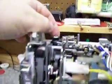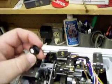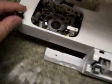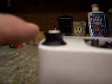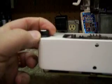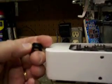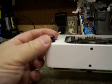Finally, one of the most important parts of your machine is the tension assembly. And this is actually called the tension encoder. And this tension encoder is a rubber wheel that is part of the electronic computerized tension on this machine. The encoder rubber wheel is very smooth on the inside, but it has a beveled area that the thread runs in. Now, if you see in this bevel that there is a line cut in the rubber, that line has been cut in there from thread. And if there is a cut in that one, it needs to be replaced. Typically, these should be replaced every 2 to 3 years on the XL-1000.